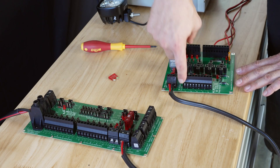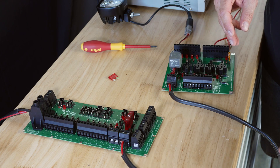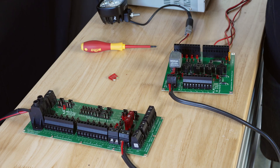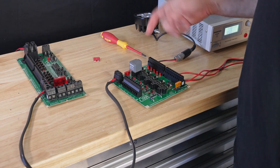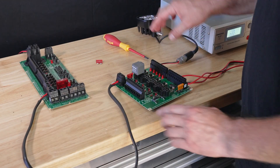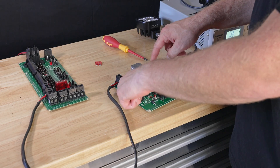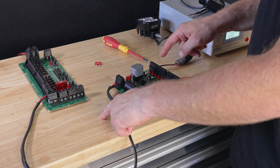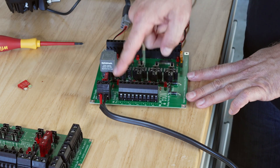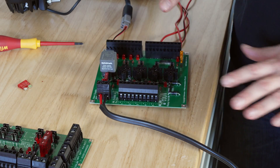You can connect to alt supply one any light that takes a constant power feed — you could even run a fridge through that or whatever else you can think of. You just have to make sure that the fuse rating and the cable size you choose is safe and correct so that you can have both loads running through the same fuse. That way you get five switched circuits and five constant power circuits, which makes this a very versatile unit.